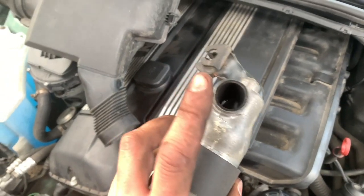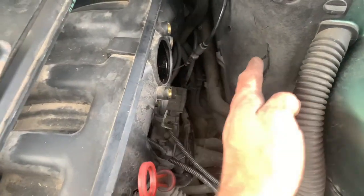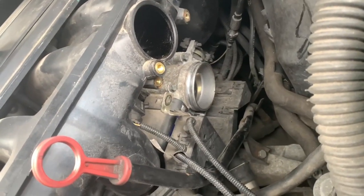There's your idle control valve – it does clip in there. There's a line on it, so you just have to give it a quick pull and it should pop straight out. And there's your throttle body exposed.